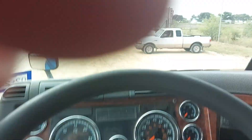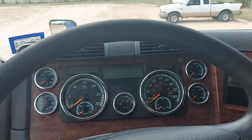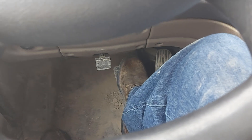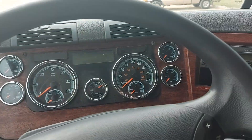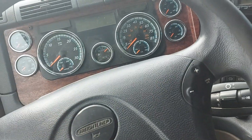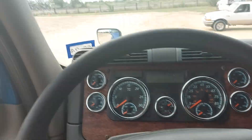I accidentally hit the stop button anyway. Seat belt okay, safe start. Put on the brake, make sure the transmission is in neutral, and then I will safe start. Truck starts, take my foot off the brake, and I'm going to basically let the truck build up air pressure.